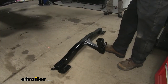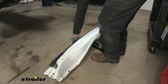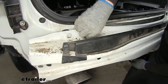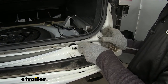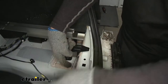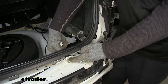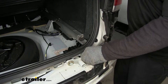We're ready to put the hitch on. I laid it down on the floor, then take the bumper structure, lay it on top, and line it up with the existing holes. Get an extra set of hands to help hold it up and put it in position. While assembling, I noticed I could see through the hole that a bolt wasn't going all the way through the nut, so I'm replacing them with the bolts that came with the hitch to ensure enough engagement through the nut.